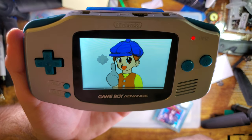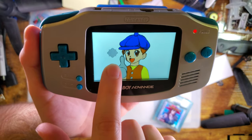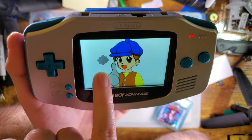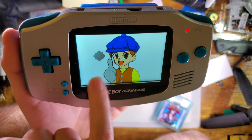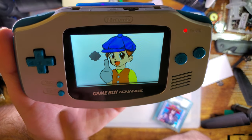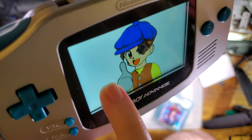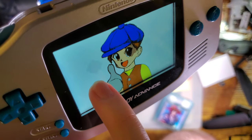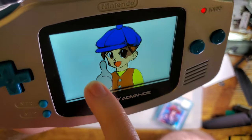I expected that behavior, but the other thing that this test allows us to test, since it puts the flickering in one spot and leaves it there, is if there's any image retention as a result of the flickering. The older 9380 based kits do have some pretty significant image retention whenever there's any objects flickering on screen, and you can move that around. I can see the same thing is present with this kit, though to a slightly lesser extreme. Again, I'm not seeing it on the phone preview, but in the actual video, I hope it comes out.